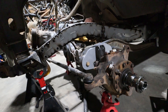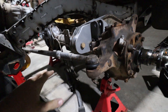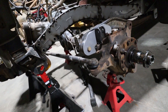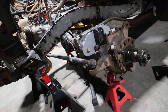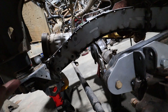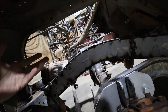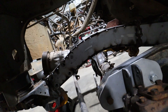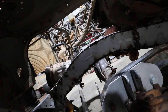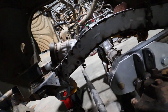We're going to put our drag link and panhard off to the side for a little bit. I'll mock them up and probably end up cutting them a little bit shorter — maybe extending the panhard — just as a space saver so I know the arms are at the length I need while I order the ones I'm actually going to use. In the meantime I'm going to start preparing for our coilover towers, which is next episode. I need to weld through all this chassis plating now because once the coilover tower goes up I can't weld behind it, so I want to spread the welding out over a couple of hours to let the heat transfer through the whole chassis and avoid any bending or bowing.